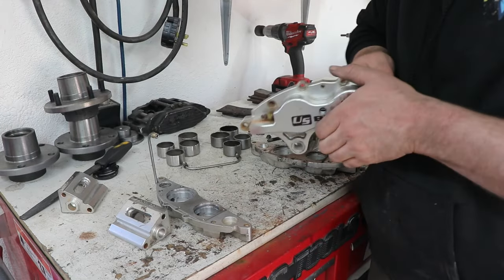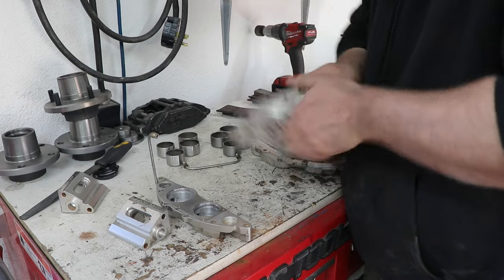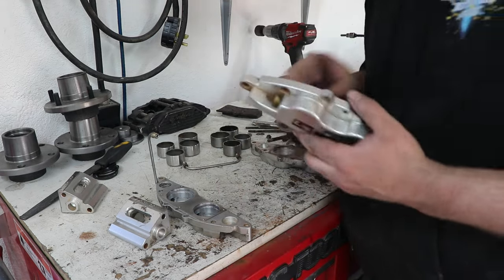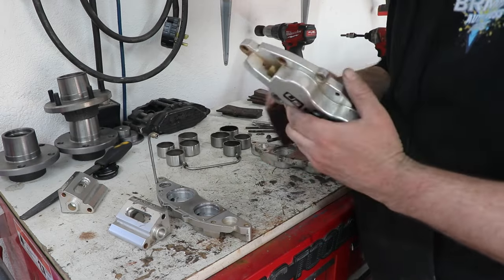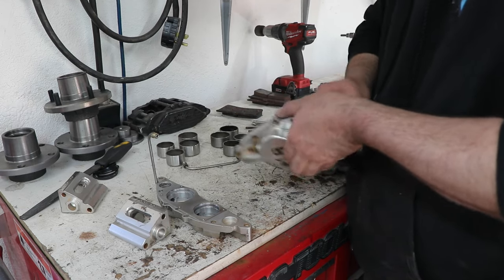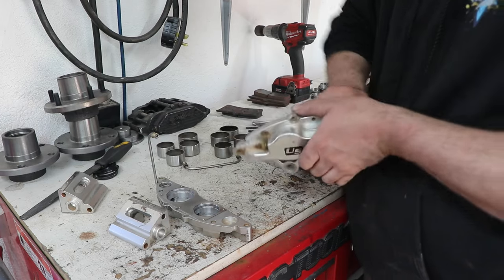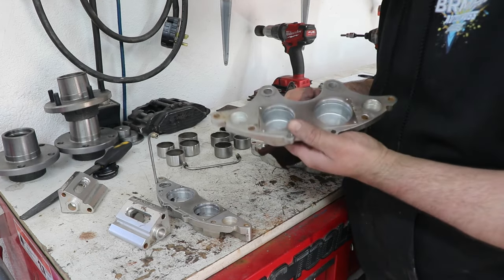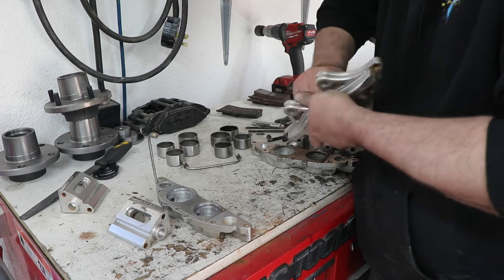I've just found, you know, these are new to me, and typically once I get them cleaned out for the first time, the buildup that I'm trying to take out here by working in that lower area is getting it cleaned up, and mostly these things have just been neglected. So once I've been using them, I typically don't have to get this involved anymore. And when a seal starts leaking, I'll just replace the seals, and usually the exposed bits on the pistons will get kind of crudded up, so you need to clean those before you put new pads on or try to push them back in at all, or you will damage the seal and it'll leak. But you take the extra time to do it now since it's the first time you've got them, and maintenance will be a whole lot easier in the future.